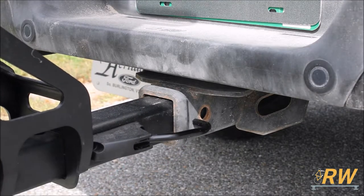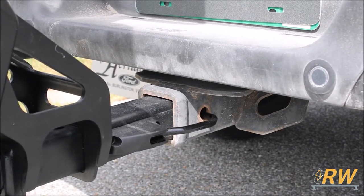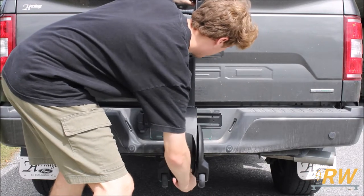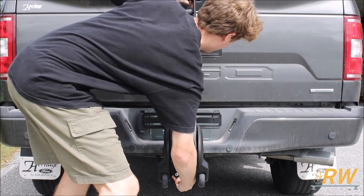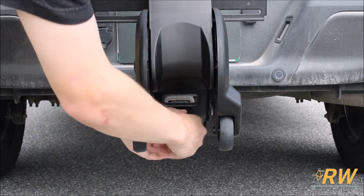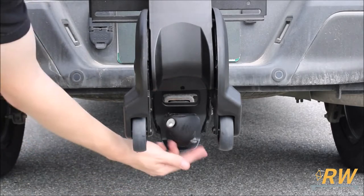A pinhole finder is integrated into the tongue to make sure you find the correct position for the rack. With the rack in place, turn this knob clockwise to tighten the bike rack into your hitch receiver. Once the rack is tight in the receiver, take your keys to lock the knob. This will disable it from being loosened or tightened any further, locking it into your receiver.